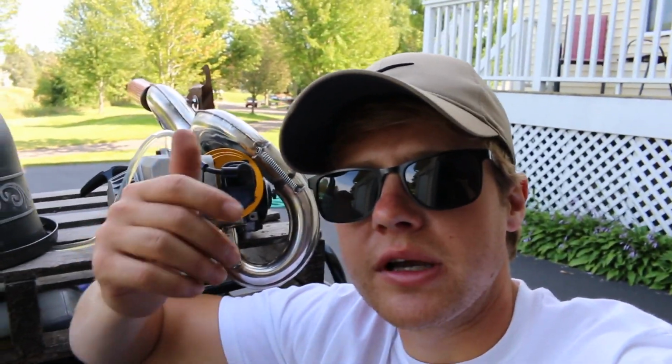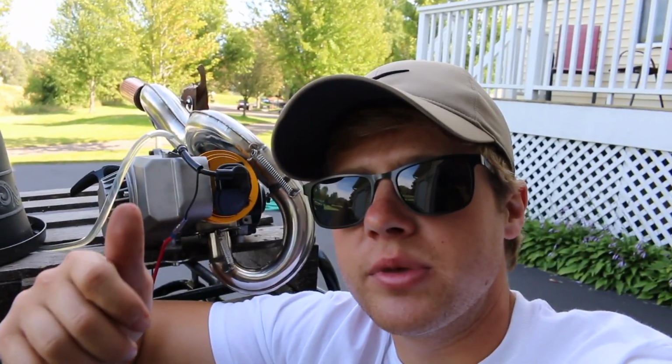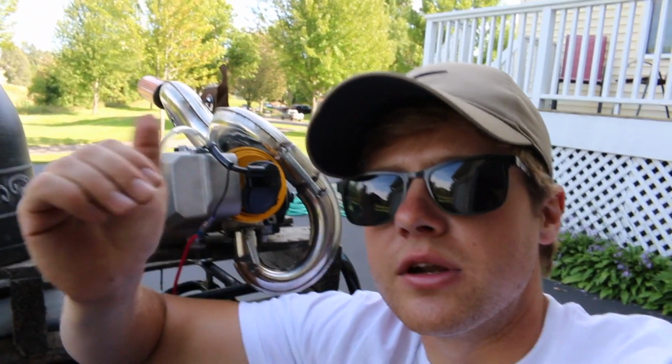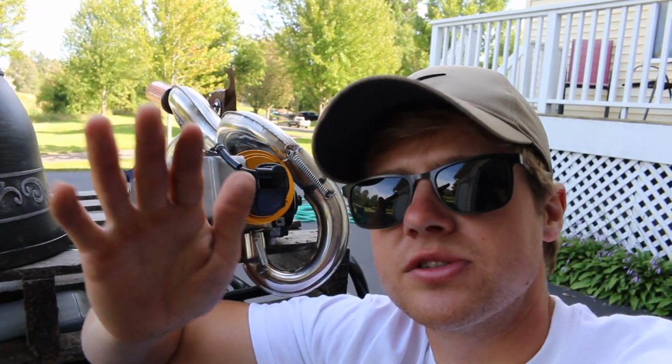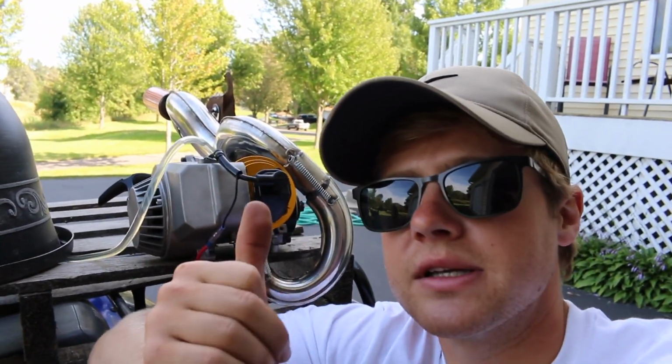And for those of you that tuned into the last episode, that piston hitting the top of the cylinder head issue, I ended up just for now stacking a couple gaskets on the actual cylinder. So now we're just running 4 gaskets between the case and the cylinder. I spent about an hour using my gasket maker and cutting out some really nice ones. So for now, that'll be the case. I didn't see any copper ones out there. I don't want this to compress so much that it starts hitting again, but for now, like I said, temporary fix.